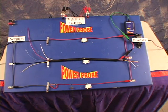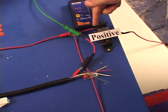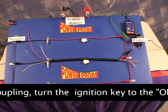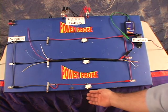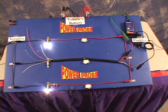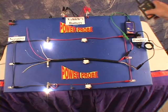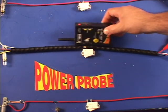There are a couple of solutions to this problem. First, we can connect the neighboring floating wires to a positive voltage. If you are diagnosing the vehicle, you could solve this coupling problem pretty easily by turning the ignition key to the on position. Sometimes, you can just turn the switches that go to the neighboring circuits on, and this will eliminate capacitive coupling. In this case here, I'm going to physically connect a positive voltage to all neighboring floating wires. Now let's trace the circuit again. The smart receiver now stops at the open switch.